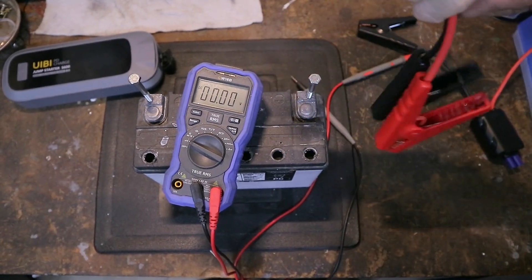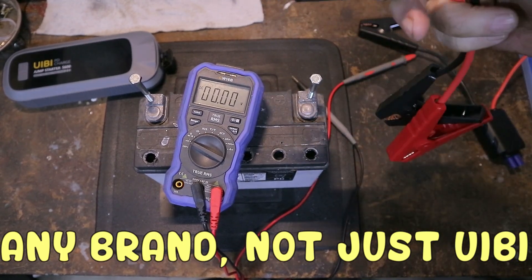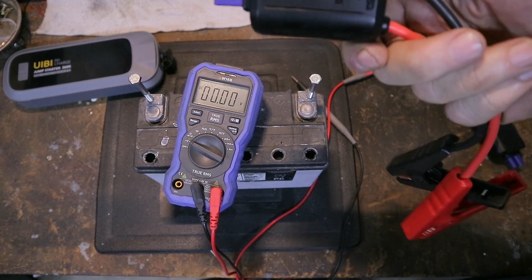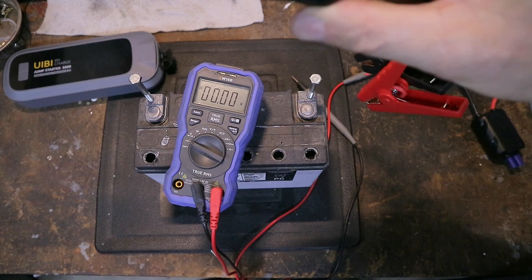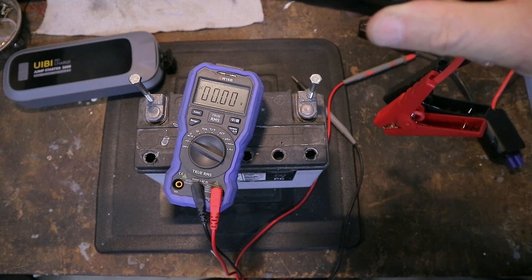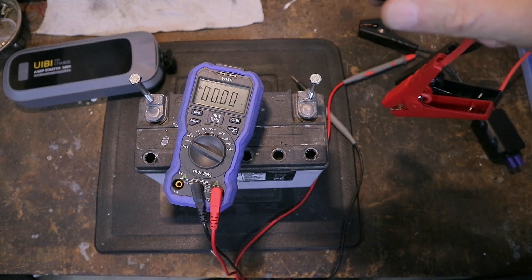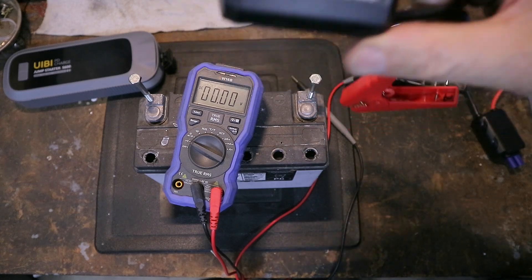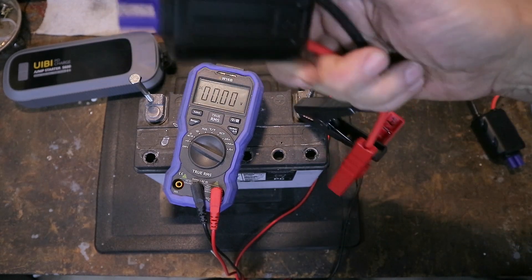What can we do about it? First, if you bought one of these and it does this - in fact, if you buy one of these things, you should immediately take it out to your car and try it. Disconnect the battery, hook it up, see if it'll run. Make sure you're getting 16 and a half volts or thereabouts when it activates. Your battery is only 12.5 to 13.5 volts - it ain't 16 and a half. So when you connect this up and it makes all the noises and the lights say it's working, test it. If your battery voltage isn't going up to 16 and a half, it's not working.